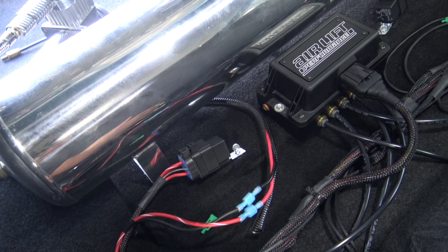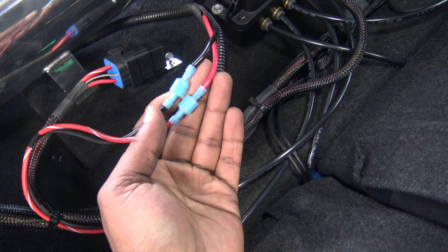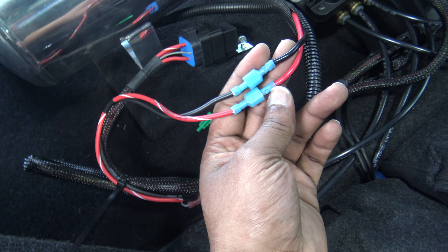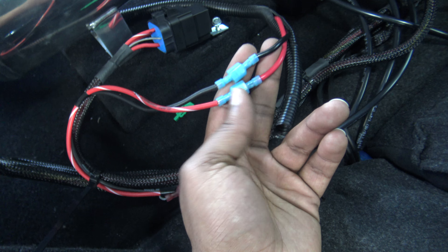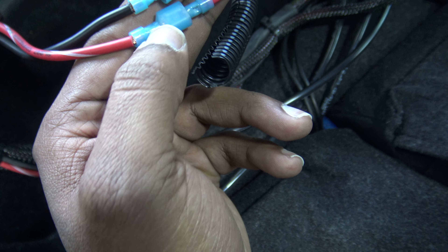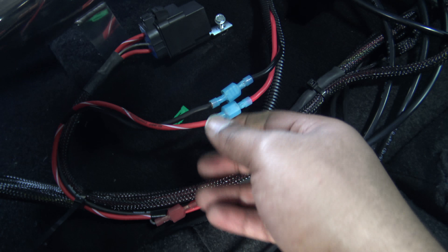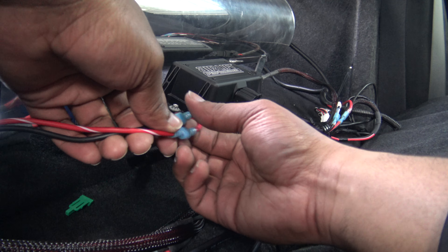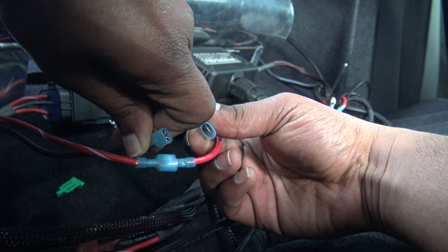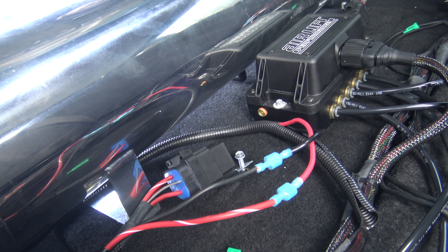If it's cold outside and your compressor is not pumping air, unplug the fuse from the compressor and wait for it to warm up, then put the fuse back in — pretty simple. I also recommend you get male and female adapters — these fully insulated crimp-on quick disconnects. I was gonna go to Radio Shack and buy some more, because when I take out both these compressors I'm gonna need new ones. They come with just the copper pieces and you crimp the middle piece down. Easy to pull apart, just like this.